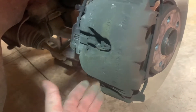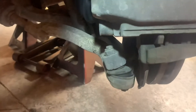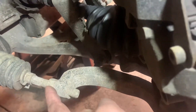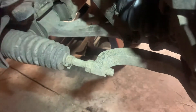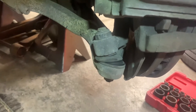The first thing I'm going to do is turn the wheels all the way to the left so I have more access to get to this. There's better visibility for us to see what we're working on. When we go to do this, we'll have to loosen this nut here, and you'll want to hold right here. This is cut just like a bolt or a nut, so you can hold this with a wrench. This is a 22-millimeter nut.